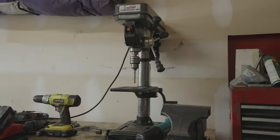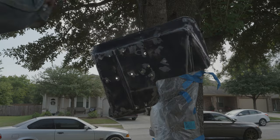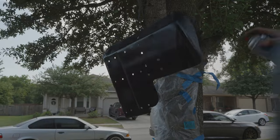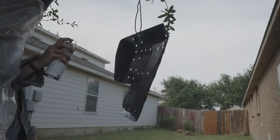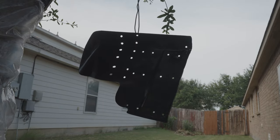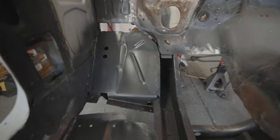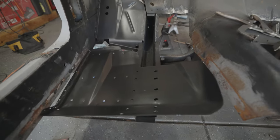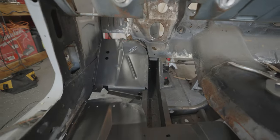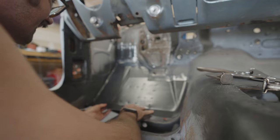Even if it takes four months, we'll eventually get it done by doing a little bit each day — that's how you eat an elephant, one bite at a time. Right now I'm painting a firewall extension for the floor pan. All we're really doing is prepping this piece so we don't have any more rust. I got this thing cured overnight, sprayed another layer of that spray on there just to make sure it's all covered. Now I'm going to get it clamped in place and remove any paint where we're going to be welding.